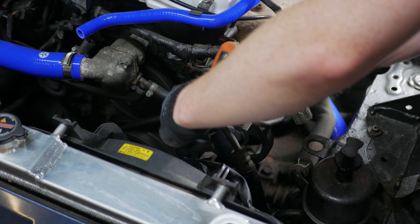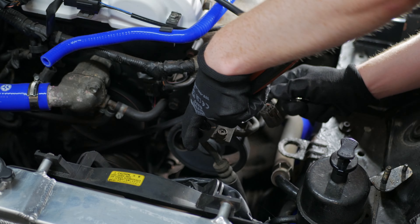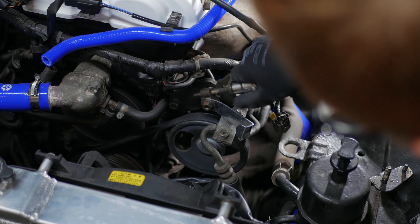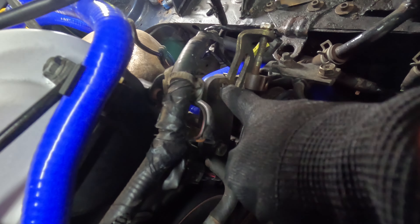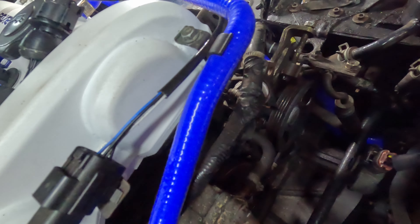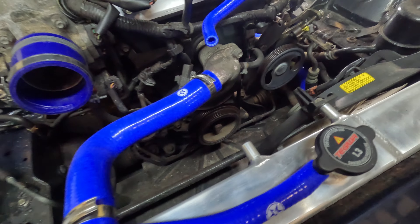Loosen off the nut just through that pulley hole, and the pinch bolt just through here with the tensioner — that's a 12 mil on that one. I ended up having to drop this bolt completely out of the tensioner so it moved freely after that. Maybe that's slightly different on some models — this is a 1.6 for reference — but now the power steering belt is off.